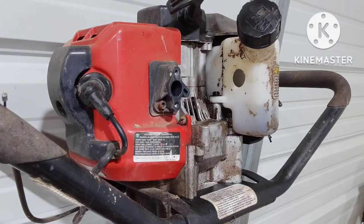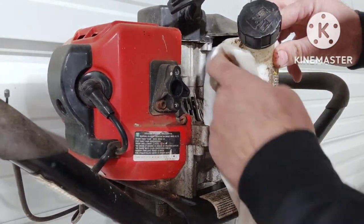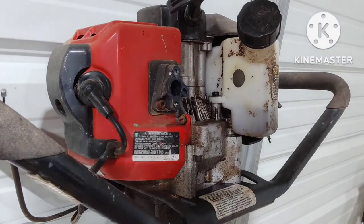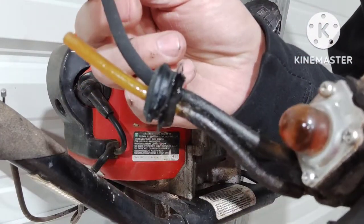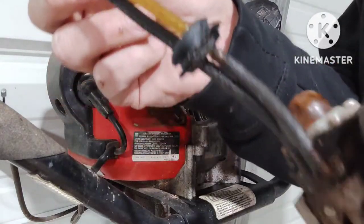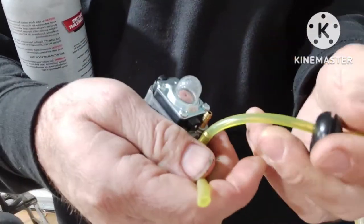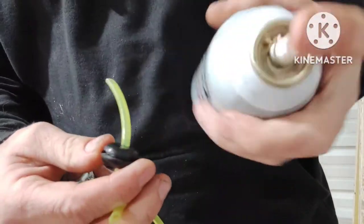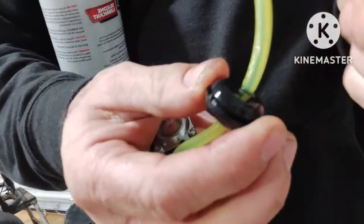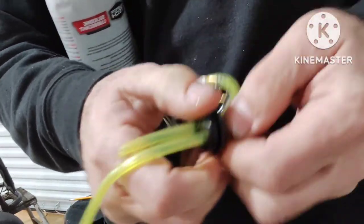Yeah, it's going to work. Alright, so let's clean that up and get our lines set up. What I'm going to do is just take this whole setup and size it up to the other one, make it all match, and then push it all back in together as one unit because I'm just replacing all of this stuff. A little trick when you're setting these up — sometimes pushing them through is a little difficult. So just take your line and spray some silicone lubricant — you can use any kind of lubricant, a little bit of two stroke oil — spray it on the line and on the rubber insert, then just push it through. Pull it to the length because it'll dry, and when it dries it'll be harder to do.